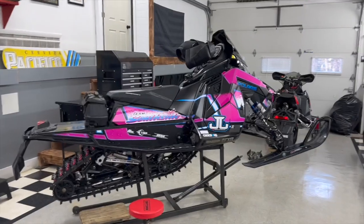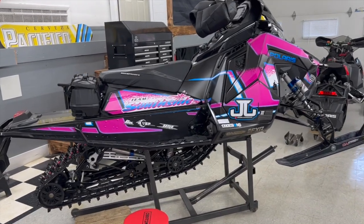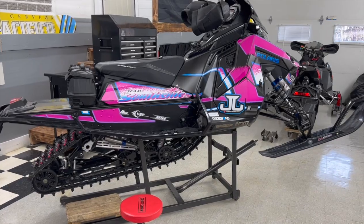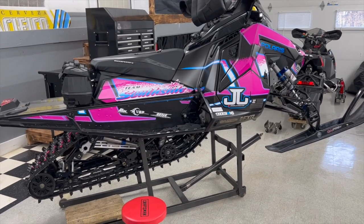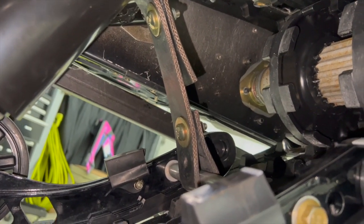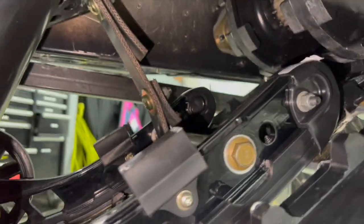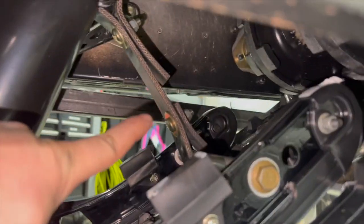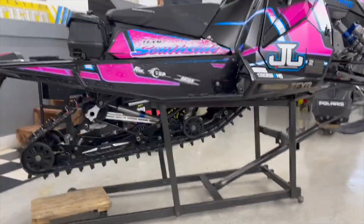We kind of know what the outcome is going to be, but this is going further than what I've gone before — actually as far as Bruce went on the 9R project, which is just a little bit longer than what the cross-country guys are running right now. We just went back together. Because I forgot to take a measurement prior to shortening it, I put it back in the standard hole: it was six and a half inches from the bump stop up to the front torque arm. After adjusting it, it is six inches. I moved the hole one inch on the strap and we shortened this one inch. I can tell that that is sucked up.